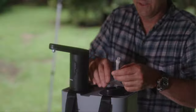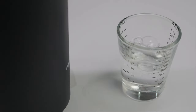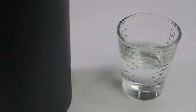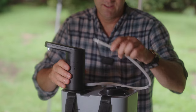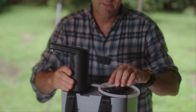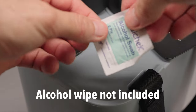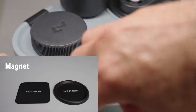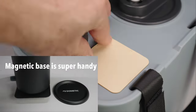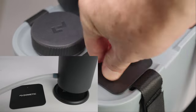Once you disconnect this here from the tank, you can run it for a few seconds just to purge that line, because there's about 30 mils of water that will sit in this line and inside the pump itself. So it's just a good idea to get rid of that water - if you don't use it for a while, try and prevent any mould building up. I stuck the float plate onto the jug with the supplied double-sided tape. I'm going to use the round plate with the lip on it for future mounting somewhere else.